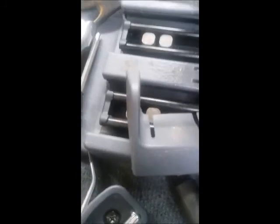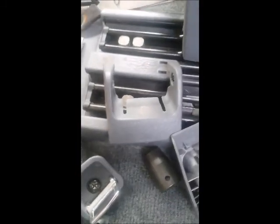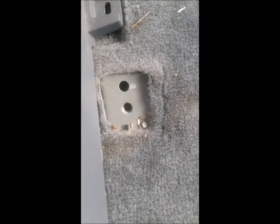After you take all of those out, what I did is I released the weather liner for the cargo, and then I came around and released the liner for here in order to get access to be able to pop this out. Now there's going to be another one down here, but you have to lift this seat up because the seat's in the way. So all I had to do was, at the leg of the seat, there are these plastic tabs. I pop them off and it exposes bolts, which go in right here. Those bolts you have to take off, and then you can lift the whole seat up. The seat lifts up and basically exposes this whole area here. After that, I was able to grab the bottom here. You have to hold it from the bottom, and then you start popping it up, up, up. And then that releases.